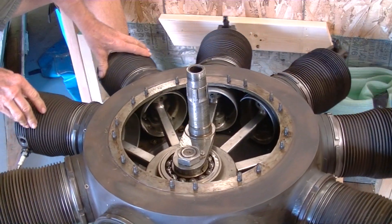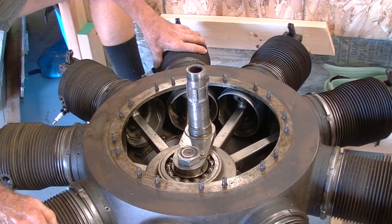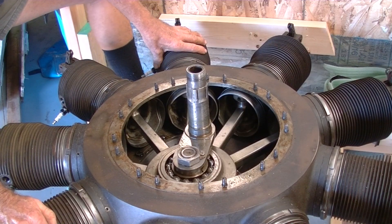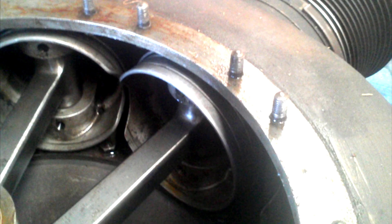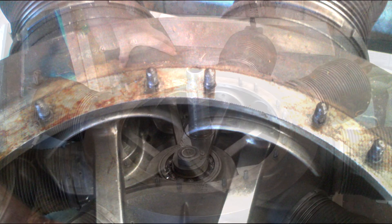As you can see, there's the crankshaft stationary and all the cylinders going around. The problem comes down to the fact that one of these pistons — we thought at first either one or eight had been put in incorrectly. One is wrong because when you get around here, you've got two cutouts joining each other, and when you get to this one, you have two pistons which collide with each other. So that was the jamming.